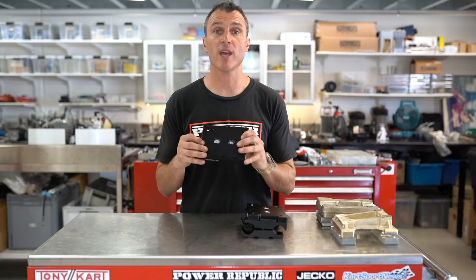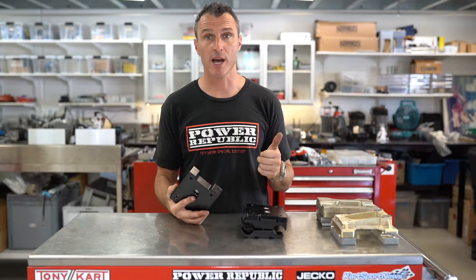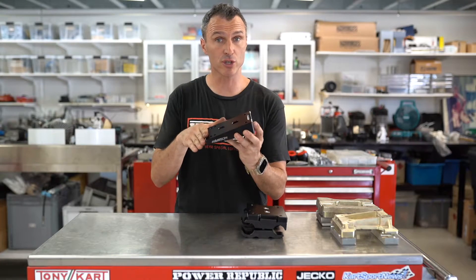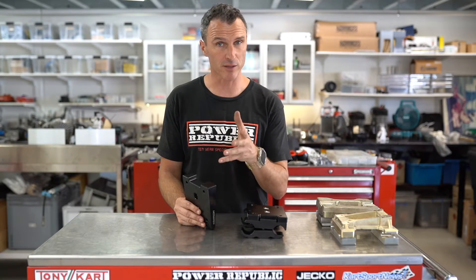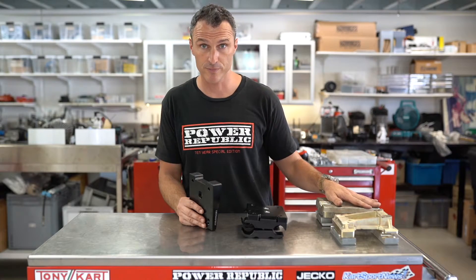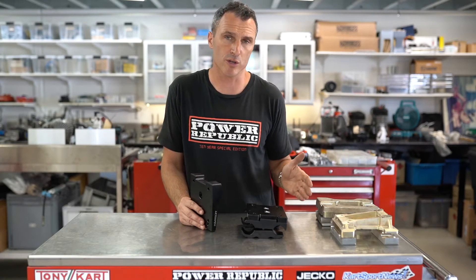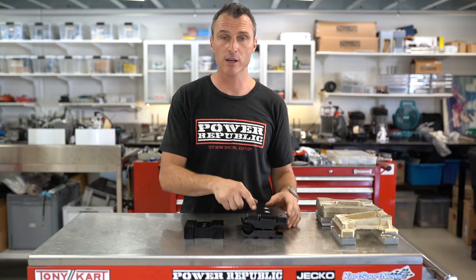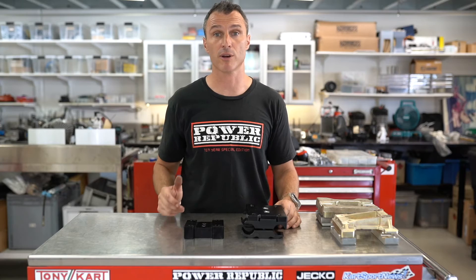We're going to go with the angled engine mount when you're having problems with the exhaust hitting on the chassis — that being the Rotax engine. Also, sometimes I like to use this wedge style when mounting up the X30 so that the starter motor doesn't foul on the chain tensioner — that's also sometimes been a problem. But a lot of guys like the flat engine mount, especially on the OK engines. The KZ engine also has a flat one that's pretty unique to that engine. Don't forget: if you're having problems with your elbow bashing into the engine as you're driving around the track, go with a flat engine mount if you can. The DPE Kartex product is excellent — I highly recommend that as well.